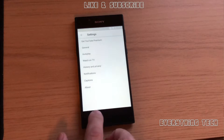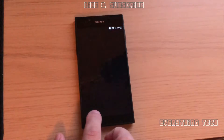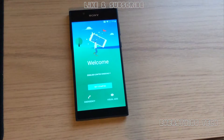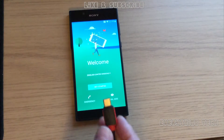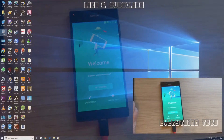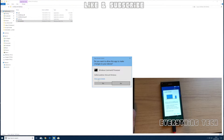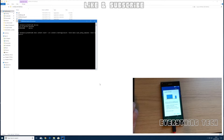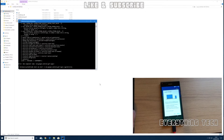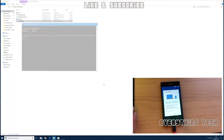It's different from the Samsung tool, so if you've already have the Samsung one, you'll need to get this one as well. Let's go to the computer now. Plug your phone in — it's an Xperia L1 so it's USB Type-C. On the computer, right-click FRP Bypass and click Yes. I like to do this two to three times, so run it a couple of times.